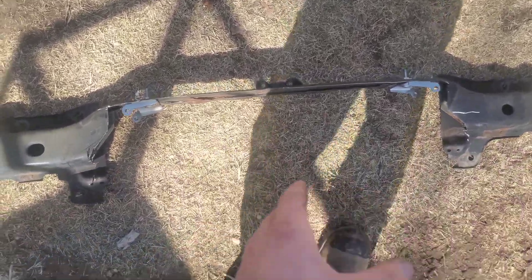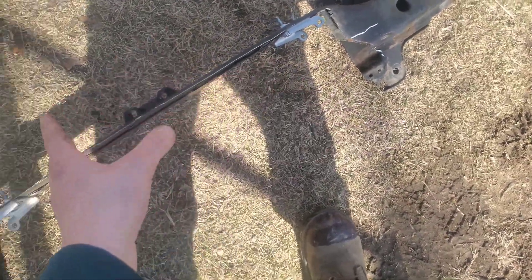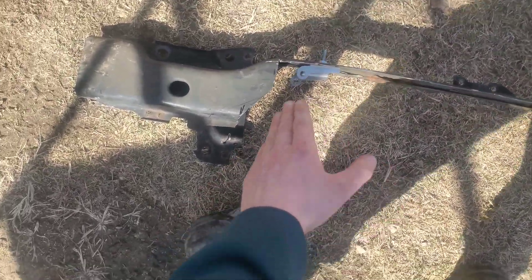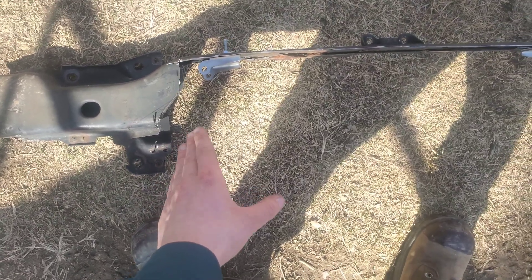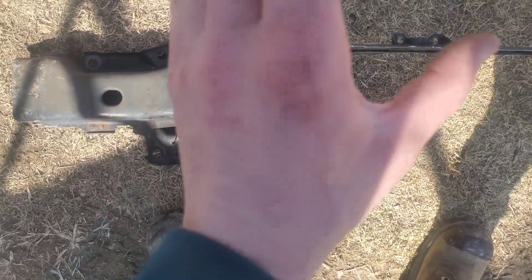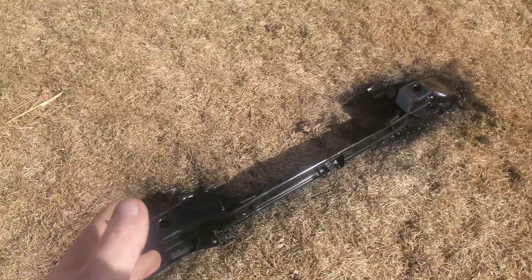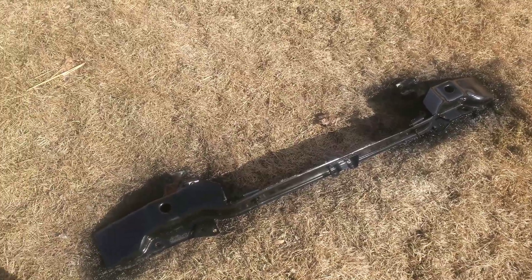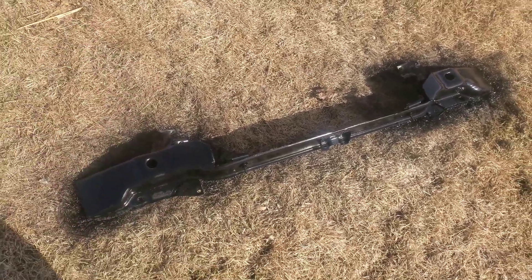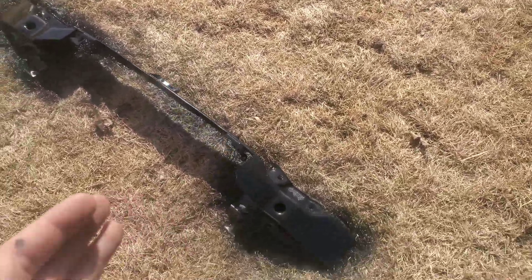Here's what's left of the crash bar — basically cut it up. I got my Vibrant intercooler mounts here with regular bolts. I have to do some more trimming because the inlets and outlets on the intercooler are too close to the bar to fit. I just got done trimming it up and I think I might have gotten a little too carried away with the cutting, and I also spray painted a little too soon.